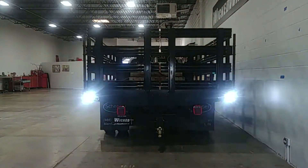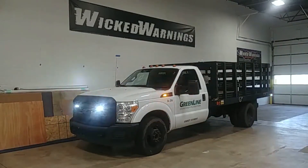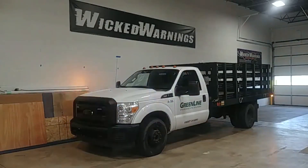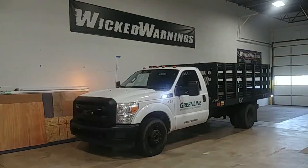You can find all of these lights and whatever accessories you need for this job on the website. This build uses just two different lights, some wire, and some heat shrink. You can find the Thin-X and the Mini Thin right over at WickedWarnings.com — we'll put links in the bottom of the video. If you have a similar truck and like how it looks, feel free to grab the products and create your own build. Everything was done using 22-5 power control wire for extending the lights, with 16-2 wire running from the rear up to the front switch. Approximately 50 feet of 22-5 and another 50 feet of 16-2 for the rear, plus a fuse holder.